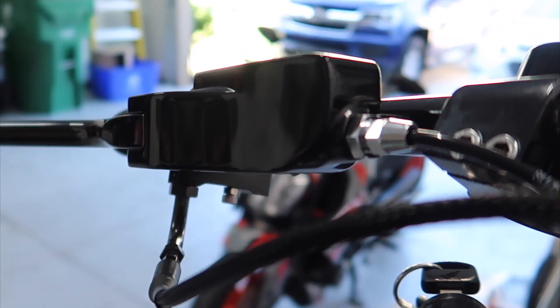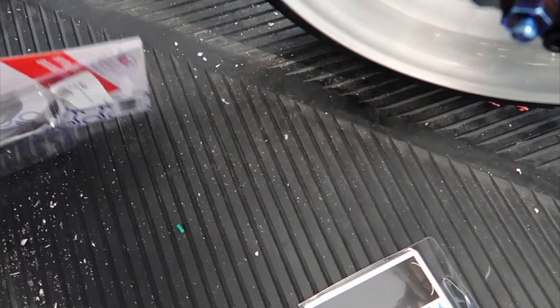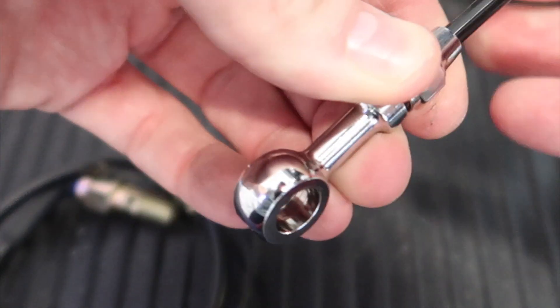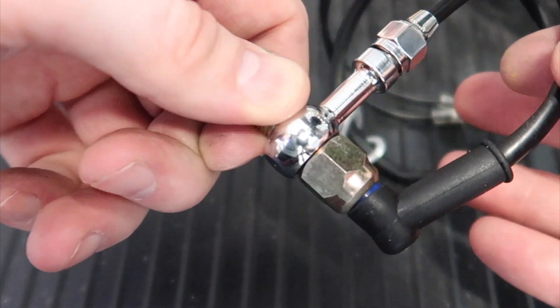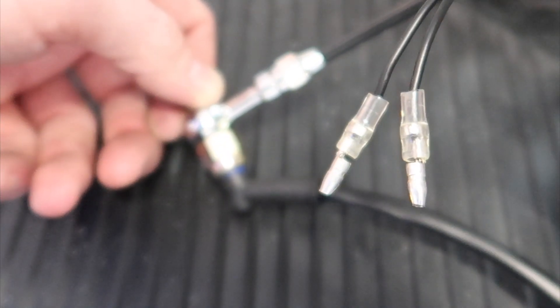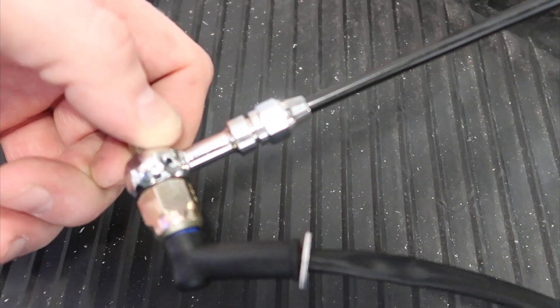Now if you noticed on this master cylinder, there is nothing for brake switches. The Ruckus needs brake switches so people can see we're stopping. The brake switch is a pressure switch, and I'm running it off a banjo fitting. Essentially, the nylon line goes into the caliper, and this is actually the banjo bolt - but it's a pressure switch. It goes in there, works as your typical banjo bolt, and anytime it feels pressure it triggers the brake switch, which plugs into the spot I left open on the harness. I don't have to have all the extra wires, and it just runs off my banjo bolt - cleaner look, no more wires on the handlebar.